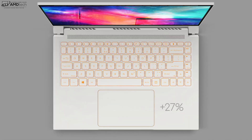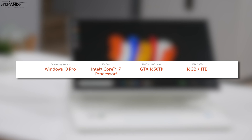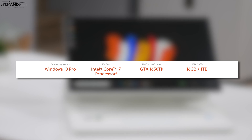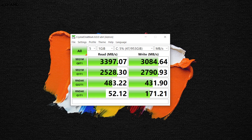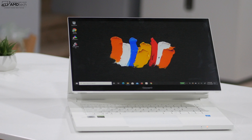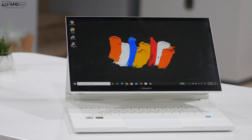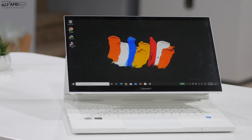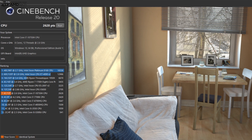The glass precision touchpad offers buttery smooth two-finger scrolling and all Windows 10 gestures worked as advertised — an excellent trackpad. For the CPU, this runs Intel's 10th-gen Core i7-10750H, a 45-watt processor, with 16GB of DDR4 RAM soldered to the motherboard — not upgradeable, so 16GB is the maximum. Storage is 1TB PCIe NVMe SSD with solid read/write speeds, and that SSD is user-upgradeable. The GPU is an NVIDIA GeForce GTX 1650 Ti Max-Q with 4GB of GDDR6 RAM, enabling video editing, Photoshop, and Lightroom.